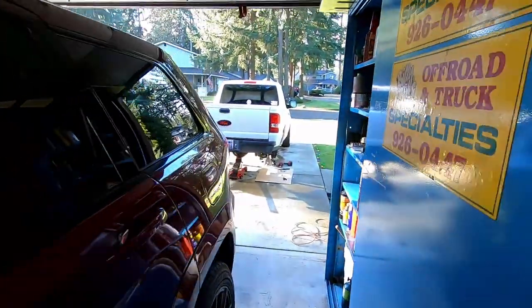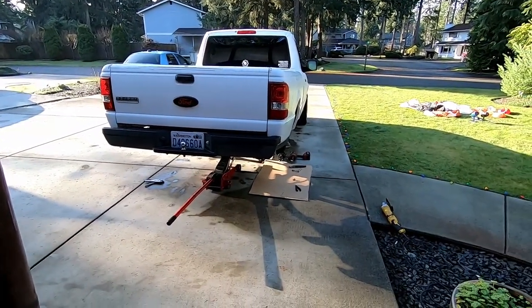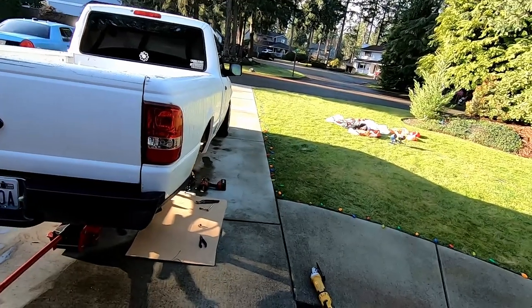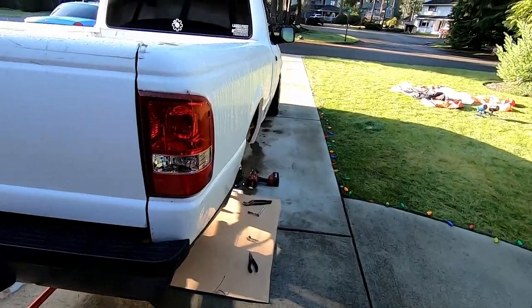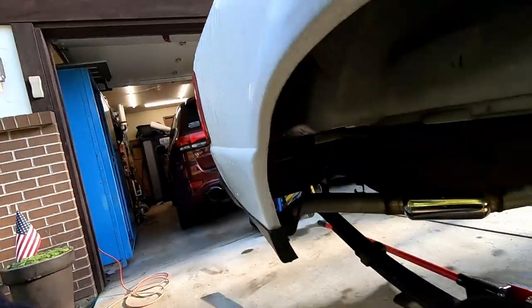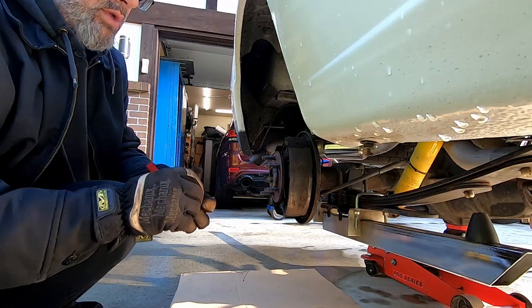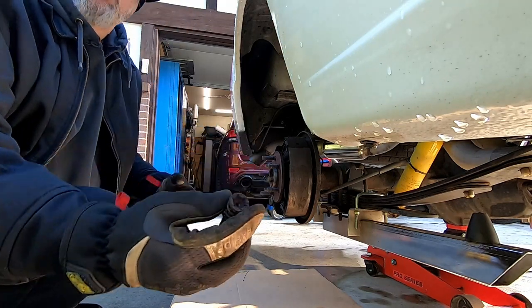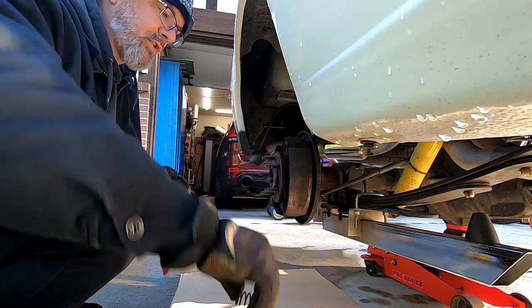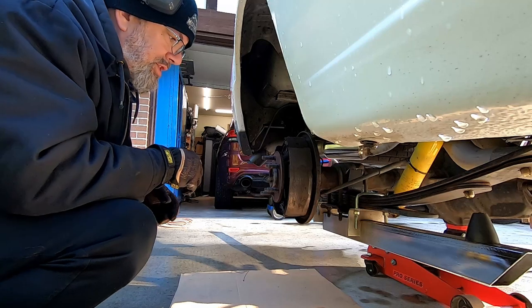It's another day — ran out of time in daylight trying to get the disc brake conversion done on the Ranger. What I want to show you is what I think is the fastest, easiest way to get all the old drum brake stuff off, especially if you're going to throw it away. Basically we're going to cut it all off, with the exception of the brake lines, which have to be undone from the wheel cylinder. We've got our brake shoe retainers off already — now we're just going to cut the springs and get all the shoes and associated parts out of the way.